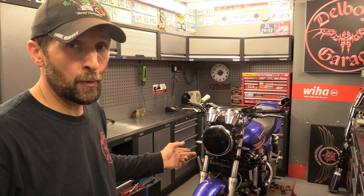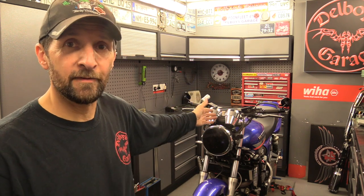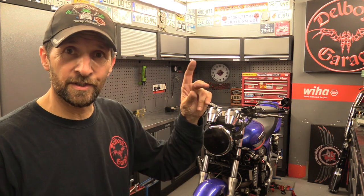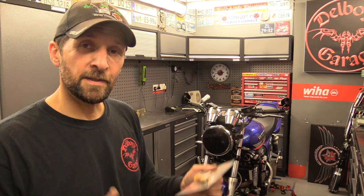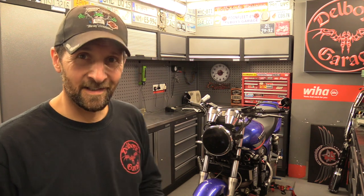Hope you enjoyed that - it's a simple process, it hasn't changed in decades and you can do it yourself. The secret is: make sure the bike is upright on its wheels, at least on a paddock stand, and make sure you do that center nut in the middle first - if you don't do that it won't be aligned. Join us next time for blinky indicators - they're indicating too fast and I'm going to slow them down with a couple of resistors. Thanks for watching, take it easy, ride safe, and thanks for all your comments.